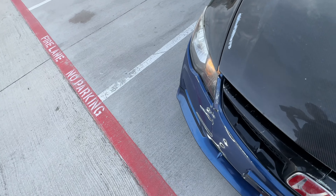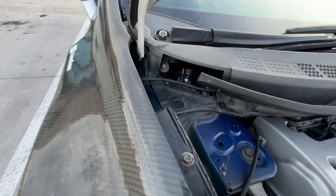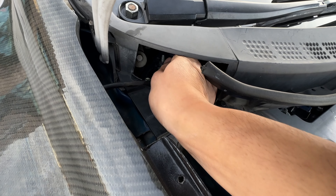It's finally time to test ride the coilovers. This is my 8th gen Honda Civic — a 2006 to 2011. I'm going to set the damper to max stiffness. All I do is go in here and adjust the damper, turning it clockwise all the way to max — that's number 24. Now, time for what I like to call the coffee test.